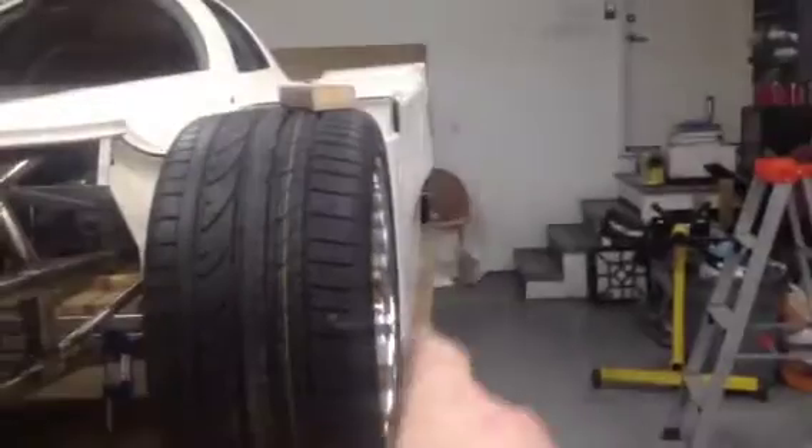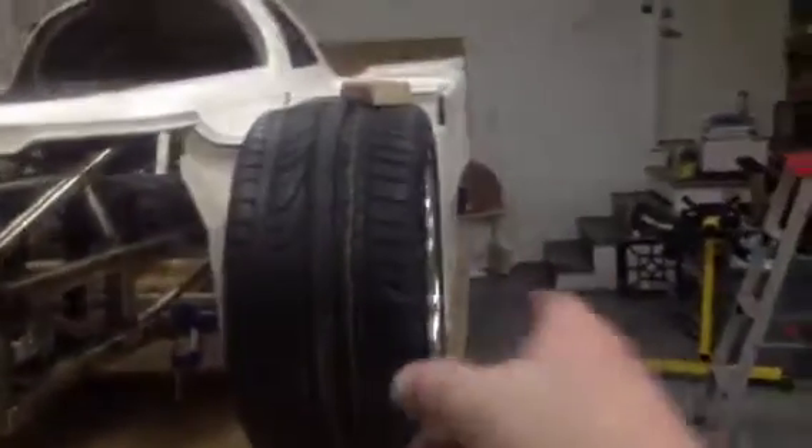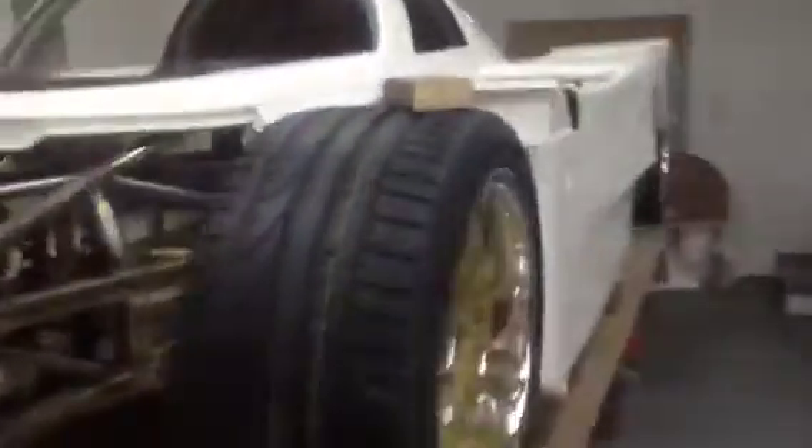You can see the sill — the bodywork above it is flaring out. I think I've finally cracked what the main problem with the body is. The sill's not too far off, it's reasonably parallel. Same with this side of the body — it's still bad, but the body follows it pretty well. It still needs a lot of work but it's not far off. What's happened somewhere is that the rear bodywork in this section on the top has twisted up and come out. The wheel arches are slightly supposed to go this way, but this section is just too wide. The silhouette of the centre section meeting the rear is correct. Door apertures are slightly wrong, but we can play with those.